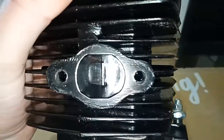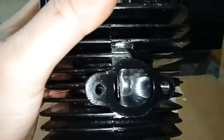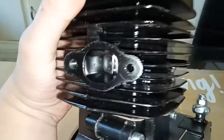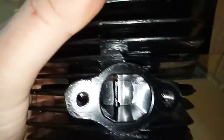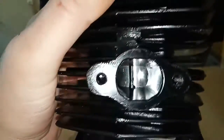That bar in the middle of the exhaust port — I had that exact same one. I'd say this is the exact same series of engine as I've got on the Mark 4 right now. Before I even put the motor on the frame, I got out the Dremel and I ground that bar out from the exhaust port, because that's a restriction and I don't like that.